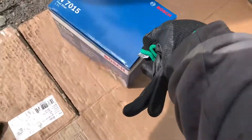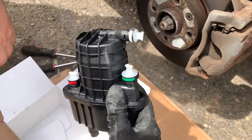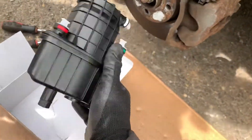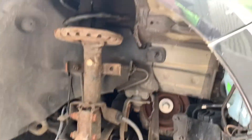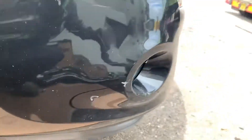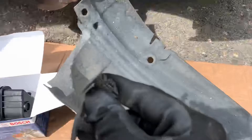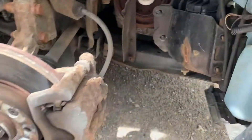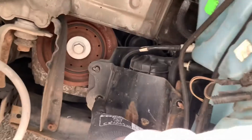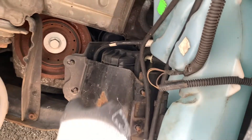And then you've got the fuel filter, which we have here, passed by the owner of the car. The fuel filter looks like this. To do the fuel filter, you need to take the wheel off. The wheel arch cover is here - it's only held in place by this plastic clip - and then you've got it here. You've got two bolts: 13mm and 10mm.